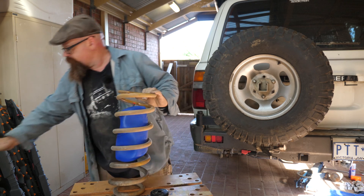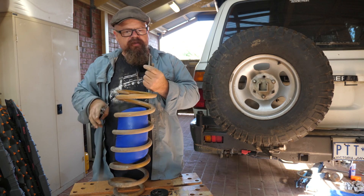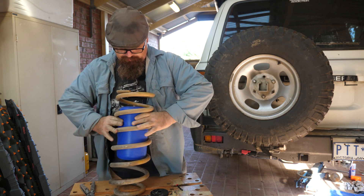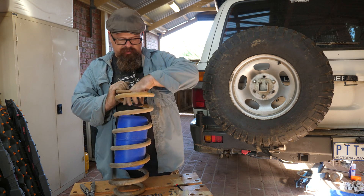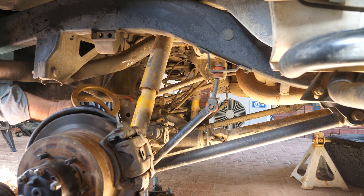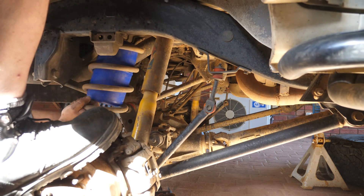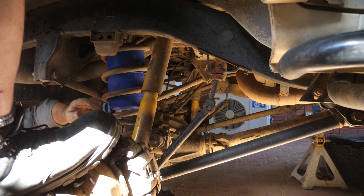Once you're completely inside, push on the collar and insert — it'll come out. Then just get in there and straighten up the bag. Don't forget you're going to need your collar on top prior to insertion. Let's go and put it in the car. Now time to put the spring back in — get your mate to put his foot on the axle and then reinsert the spring. Make sure it falls into the slot on the bottom.